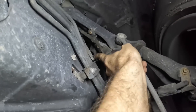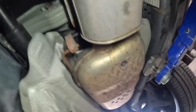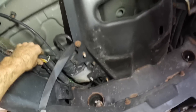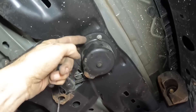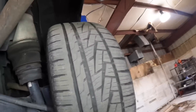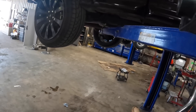Both ride height sensors look connected. This is going to take a lot of research — I don't have much exposure to servicing these vehicles. Found the air ride pump and control circuits. There's also the broken spare tire crank they mentioned — somebody used an impact gun on it and it's now stuck, probably springing the cable inside. No obvious suspension damage other than those improperly installed parts. Lowering the vehicle.